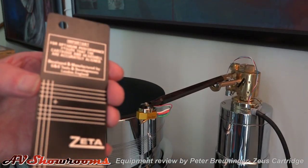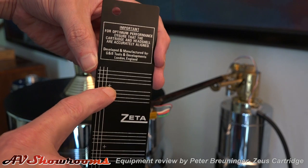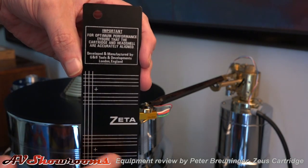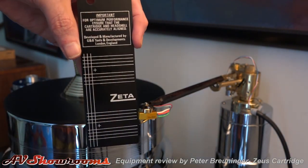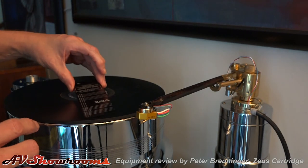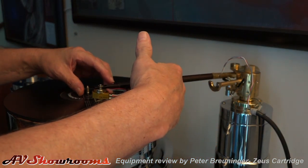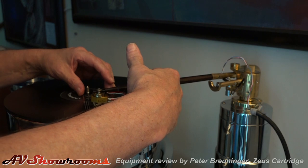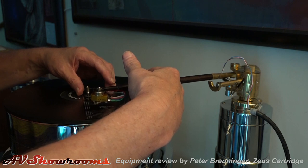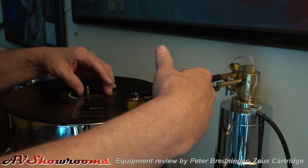For the initial cartridge setup I use a two-point protractor. You want to get the cartridge to have the stylus fall right in that crosshair, and then align the parallel line to the sides of the cartridge. Ideally the stylus too. Let's go ahead and do it — take the clamp off, that's right over the spindle, put it right down there and right over the crosshair. Looking over the top, it's a little off here and has to be twisted out a little bit on both points.